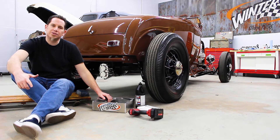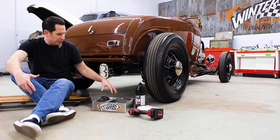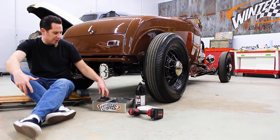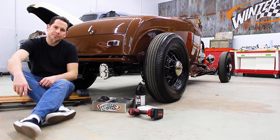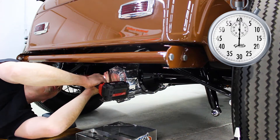When you're changing the gears in your quick change you can use any oil pan to catch the oil that drains out of the rear. We prefer these quick change drip pans because they have a built-in shelf that you can set your gears on — it's perforated and lets oil drain out into the pan. First step is to slide your drip pan in place and remove the rear gear cover.